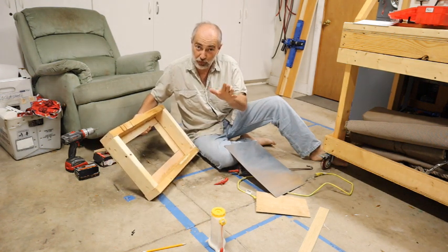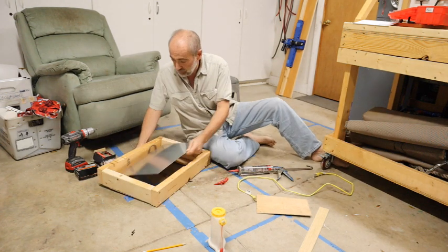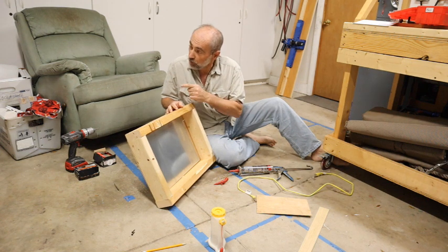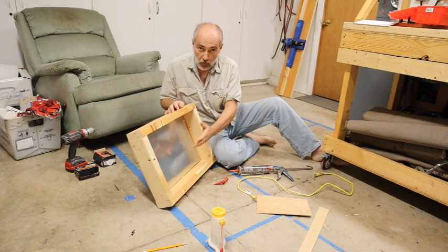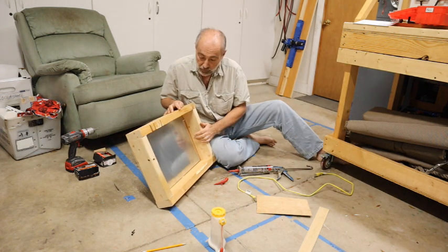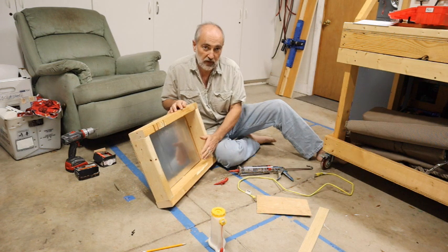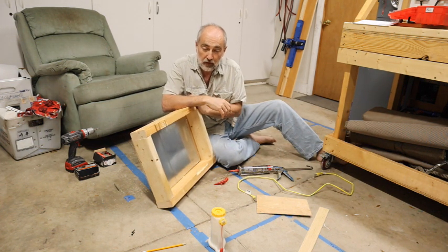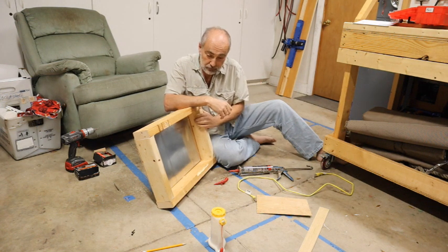This is just really crazy. I made this little box where this steel represents the steel wall of the van. I'm going to take the door off my mini fridge and put insulation in here, right up against what would be the van wall, and see where the condensation forms. I'm definitely not going to use spray foam, but do I use poly iso, do I try a vapor barrier, or do I just let it breathe? I'm going to do an experiment to see what's truly better.